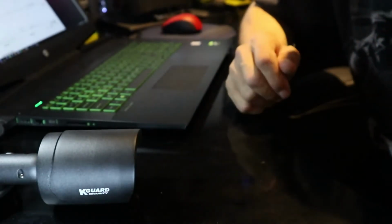Many devices have them. So I reached out to a friend, Francois Bakker. Francois, thank you. He informed me that a default IP address for cameras can be 192.168.1.100 or 192.168.0.100. So what I'm going to do now is configure my LAN card on my PC to have a fixed IP address, and then see if we can access the camera using one of those two IP addresses. Give me a couple of seconds.